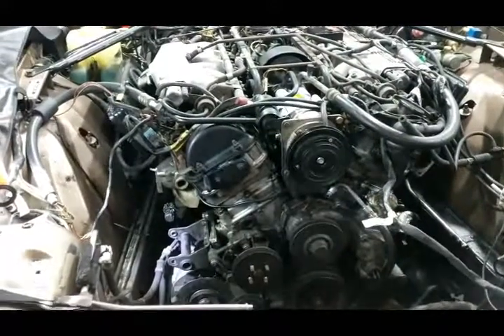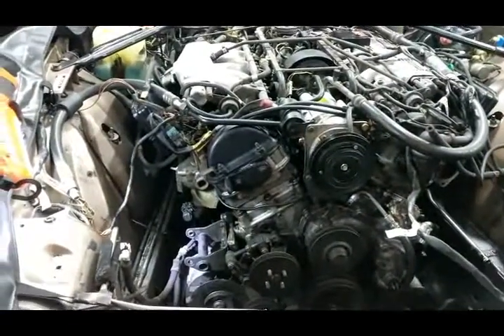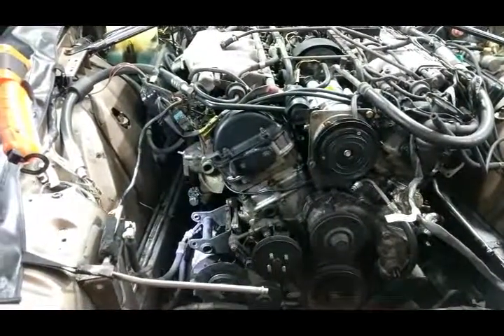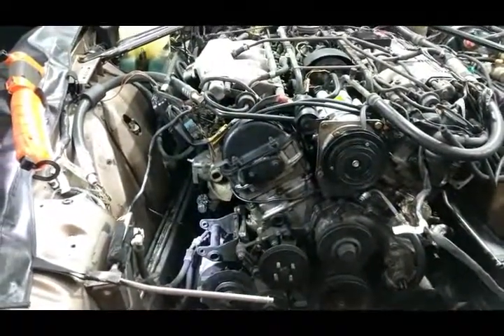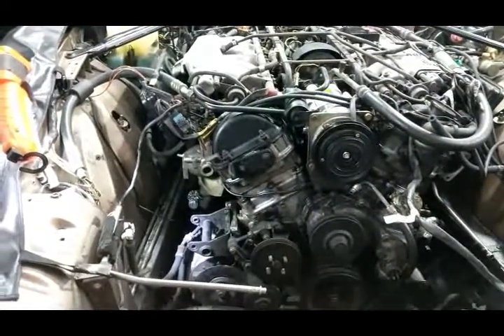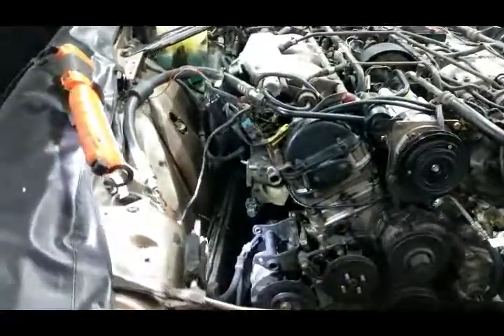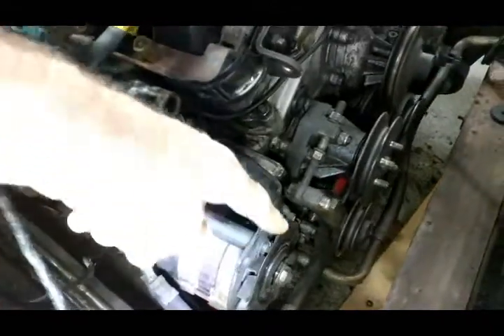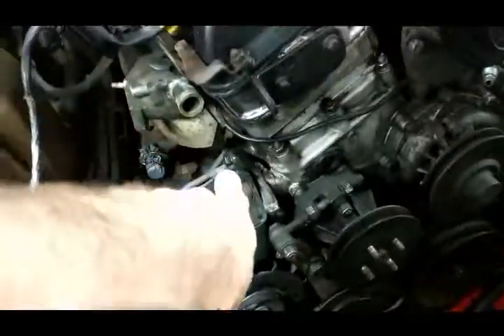Today I'm looking at the auxiliary air pump and trying to get it working again. I did contemplate just replacing it so it didn't seize and break the belt and create problems, since I'm in here doing the cooling system anyway. The pump attaches here, has a belt on the front through a pulley, and takes its drive off the crankshaft out the back.